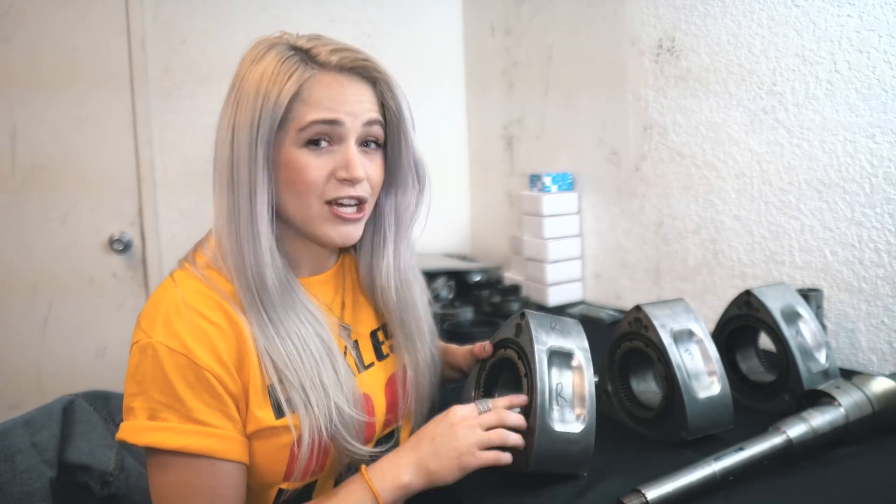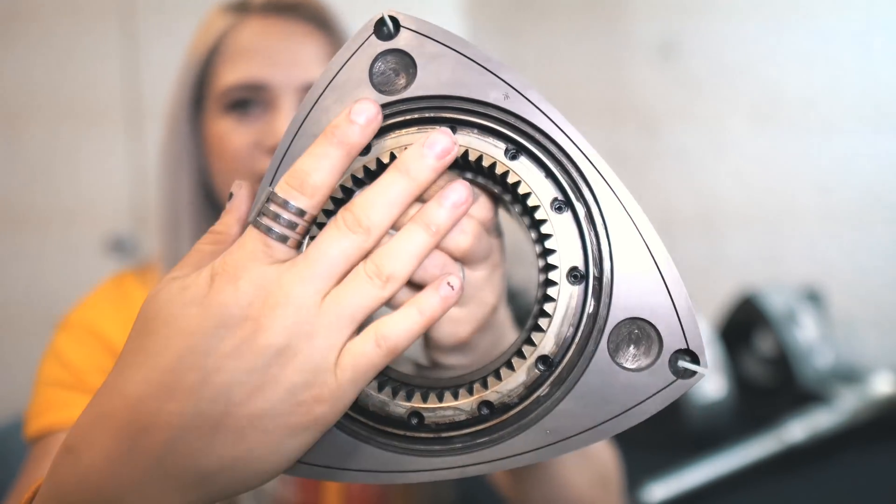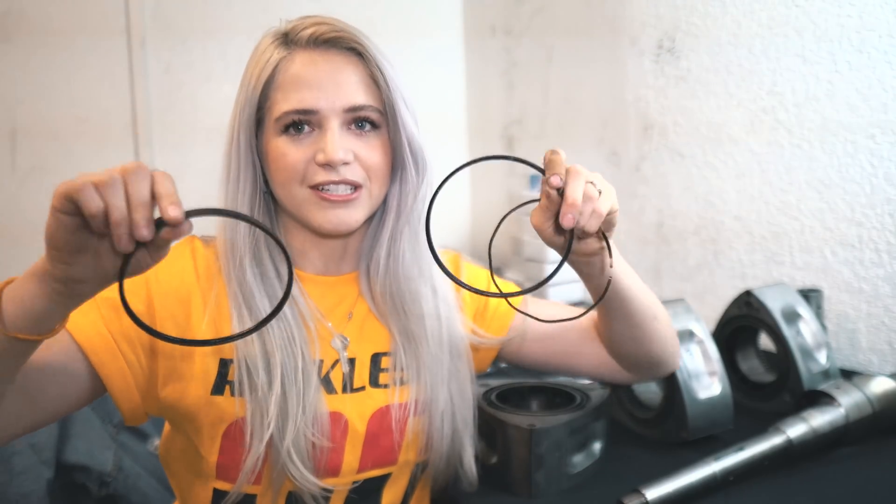For the purpose of everyone being able to follow along easily, we're gonna have a quick Rotary 101 for today. I'm reassembling the rotors — I'm actually using all of my 20B parts to explain this, but we are rebuilding the 13B on the channel first. What goes into rebuilding the rotors is mostly installing all of the seals. There are three main seals on a rotor as well as oil control rings. The first thing I'm gonna be doing is installing the oil control rings — there are two: one on the outside and one on the inside.